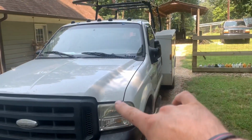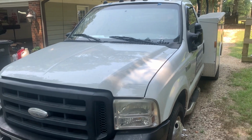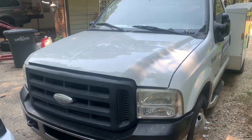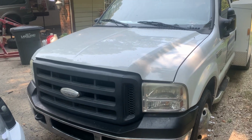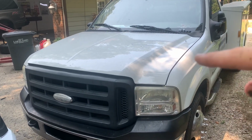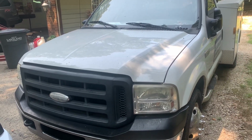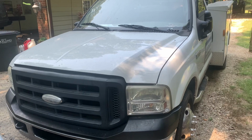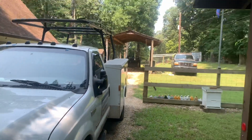This is a 6-liter that was just delivered to me from someone else that recently started using me. And they were told by another shop it needs a motor. I got it to start. It's really slow to build high pressure oil. So I've got some kind of leak in the system, whether it's injector or injectors, STC fitting, who knows. It's an 07, so it may not have ever been opened up. It's only got 200,000 miles on it.